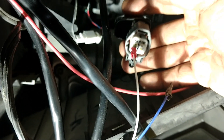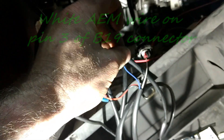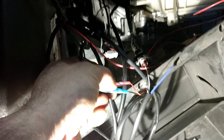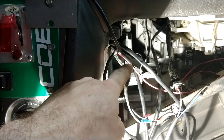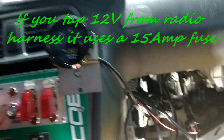Looking at the wire colors in the back, pin 3 is the white one and yellow and red should be at the top right. I put the white signal wire coming from the AEM here. I cut the blue wire — that's for the serial port, which we're not using — and taped it off so it doesn't short anywhere. Red is power and black is ground. For power, I tapped into the radio power and added a 10-amp inline fuse.